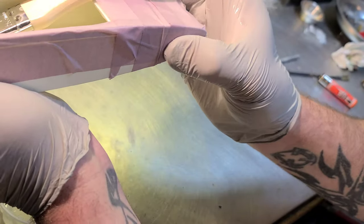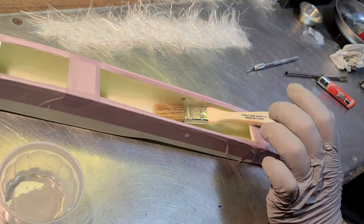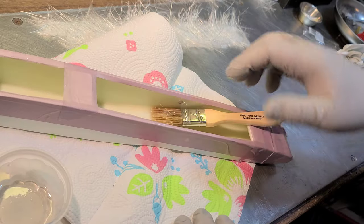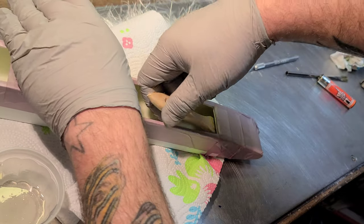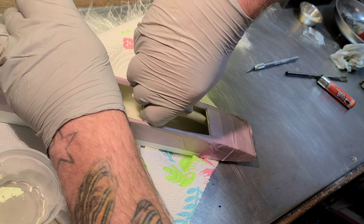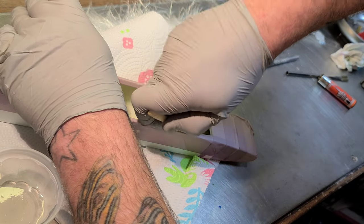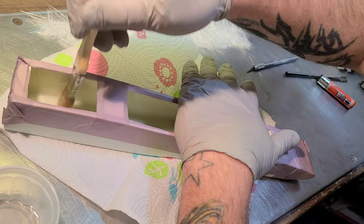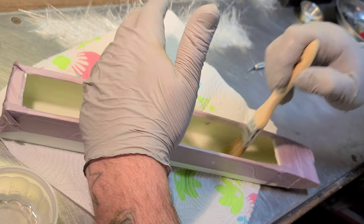See, I got tape over my boom tube holes, making like an epoxy dam, basically. So when we're brushing that brush over it, it's not going to leak out the sides and ruin the finish of the boat. But we're really going to reinforce it now that I found that it's only one ply of woven cloth epoxied in over this plastic.